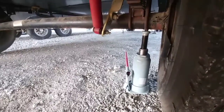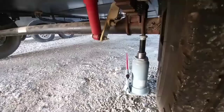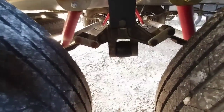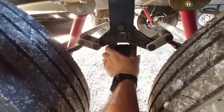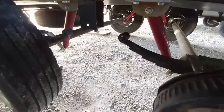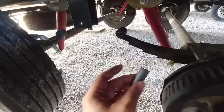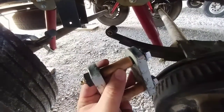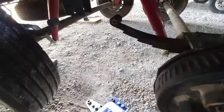I've positioned a 12-ton bottle jack right underneath the U-bolt on the axle to be able to adjust the axle up and down. You really don't need much there — you are just wanting to articulate the axle up and down so you can access the equalizer. As soon as we took pressure off of the tires and axles, all the components essentially move freely now. All I need to do is unbolt everything and drop it down, put the new one in place. Also, the Moride kit comes with brass bushings — we are removing the Lippert Never Fail bushings and installing these brass bushings with the wet bolt kit. A little more maintenance, but they should probably never fail.